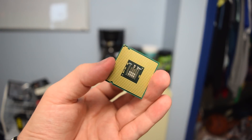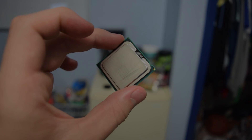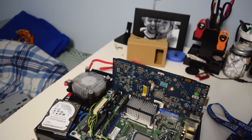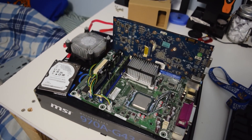That being said, an overclock could fix some of these issues, but in this scenario — when you are upgrading a hand-me-down system that most likely doesn't have an overclockable board — I would advise you to upgrade the CPU first, and use whatever leftover money you have to buy the best dedicated GPU that you can.